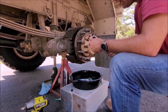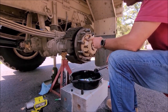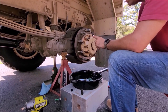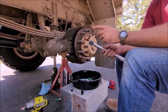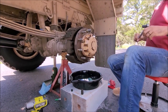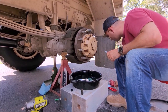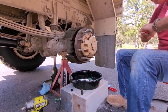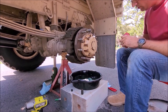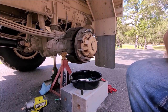The TM on these — I thought it had a sequence to tighten them. I'm going to have to get the right size socket. Use common sense and crisscross, sort of like doing your lug nuts. It's 35 to 50, so I'm going to do 45. Went all the way around. My gasket maker keeps squirting out here making a mess. It says to install and then let the vehicle sit for an hour. I'm going to put the plug in there just to make sure dust doesn't get in.